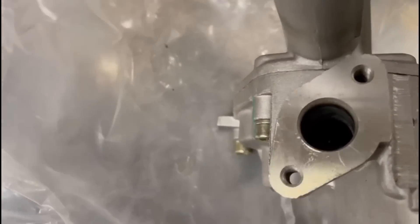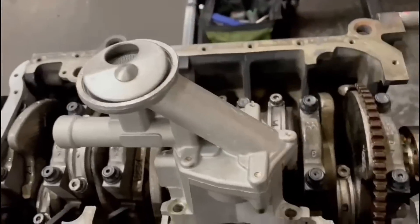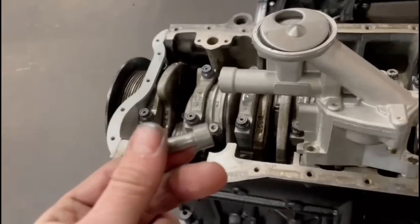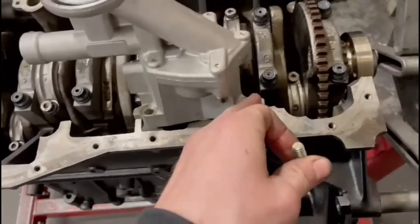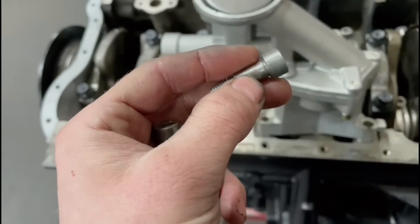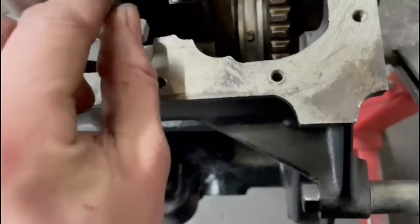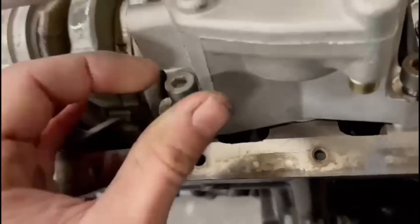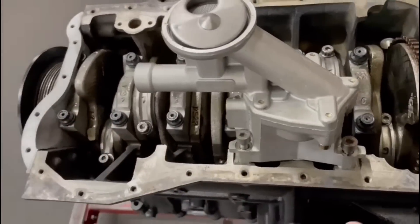So I'm just pre-filling the oil pump and using this oil pump shaft here to just make sure there's oil running around the whole thing. Right, so the brand new oil pump is on. I had to actually modify these bolts - the old oil pump holes were slightly bigger for the oil pump bolts. So rather than drill these out bigger, I just ground the shank of the bolt down very slightly so they fit, because they were too tight. So these now should go in fine. We'll leave it like that and then put the pickup on, then bolt the whole thing on together.